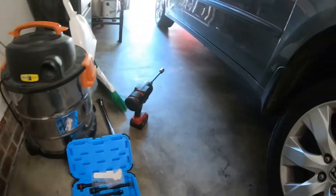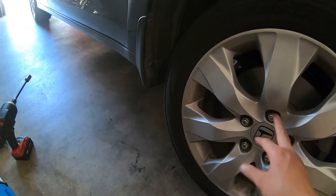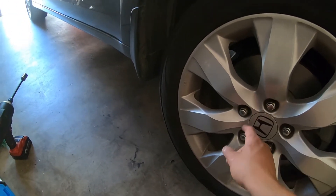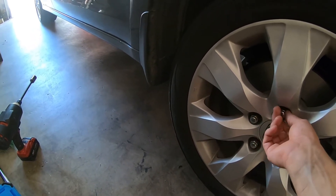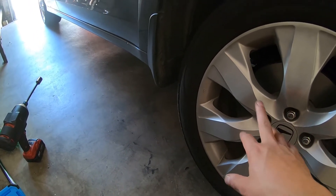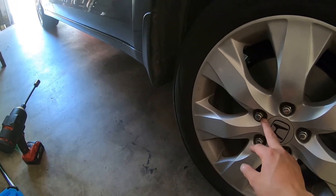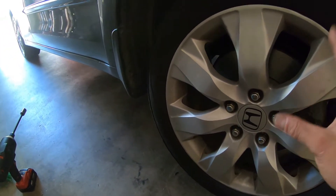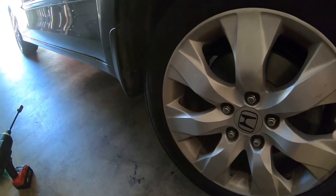When you have your wheels and you put them back on a vehicle, you need to torque them. I recommend torquing because of aluminum wheels — if you put too much on it, I've seen people actually chew up the mount where the bolt comes on, and I've seen people crack them before. Especially with aluminum wheels, you've got to be careful. If you over-torque, you cause a lot of issues. You can also strip the stud and then you have to redo the stud. Torquing wheels is always a good thing to make sure they're properly fastened — that way you don't get vibrations and you don't have to worry about your wheels falling off.